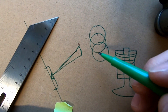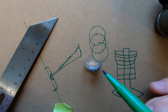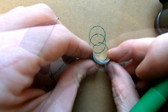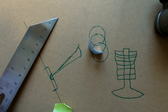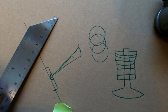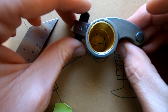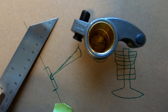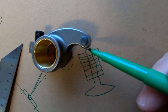What B3 does is actually give you a shim spacer. It looks like this — it's a little half moon, thin on one side and thick on the other. It will raise that shaft. Just imagine we go to the center hole now. It raises it and brings it outward. So if we line everything back up, it kind of positions our roller more centered on top of the valve.